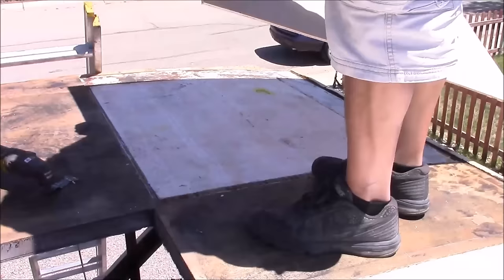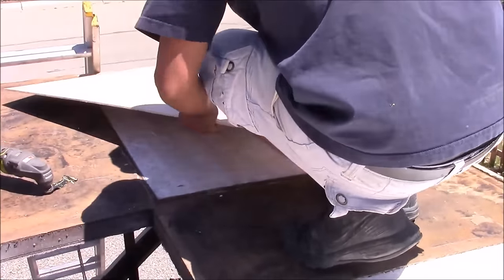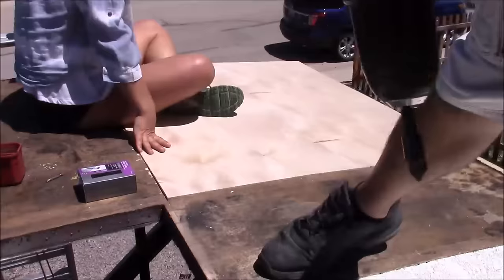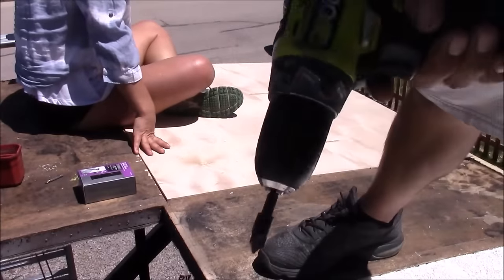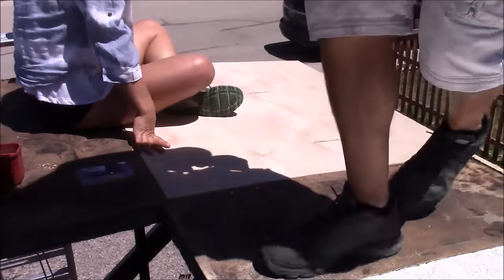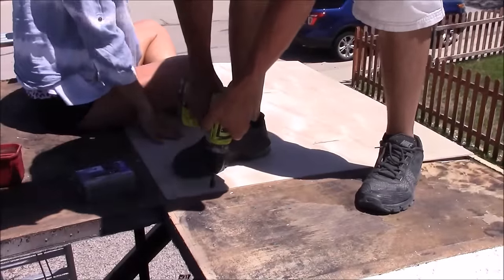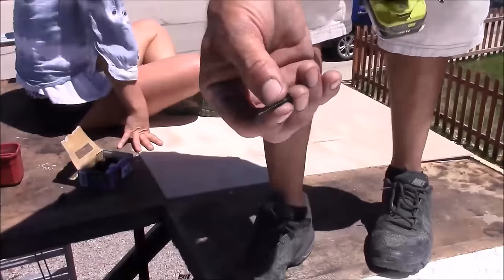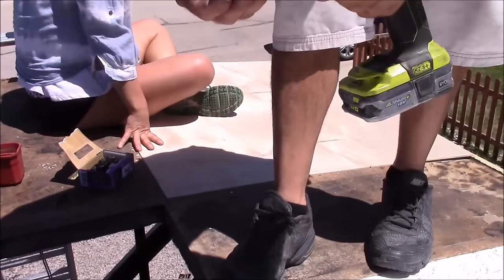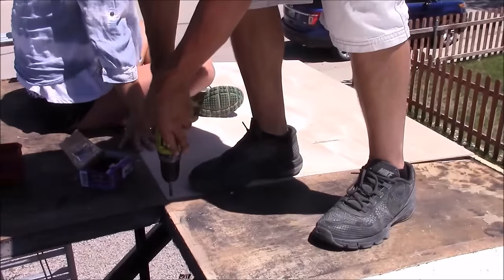For the plywood I'm using a quarter inch underlayment that's moisture resistant, purchased from Home Depot. I'm going to dry fit this piece first by pre-drilling some holes and using a countersink bit to make sure those screw heads get flush. The seams on this piece line up with the steel tubing underneath and I'm going to drill a hole every five inches to secure the panel. For screws I'm using a wood-to-metal self-tapping screw, and for now I'll put a screw in each corner so I can line out my panel easier after applying the adhesive.